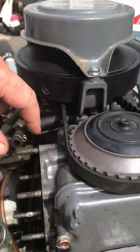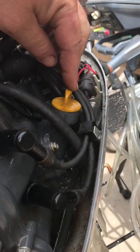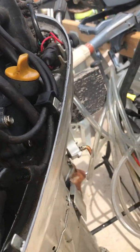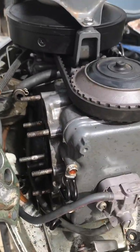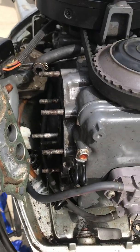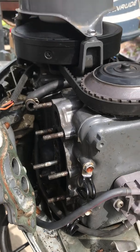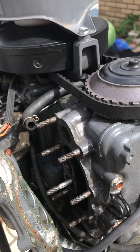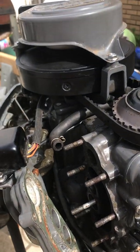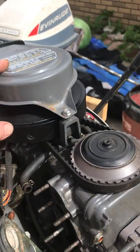The water line comes in through here, coming down — of course it's right next to the oil sump. Maybe that's a factor, but the way this thing was blocked up and the way everything started with the thermostat when it got hot makes me suspect the thermostat. I'd really like for this motor to get running again — it's a cool motor and I really like the four-strokes. This thing comes right off super easy.